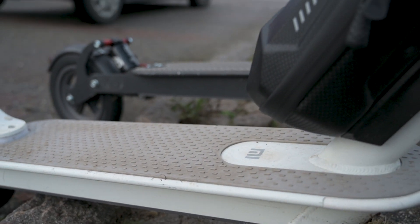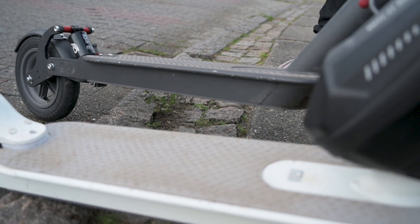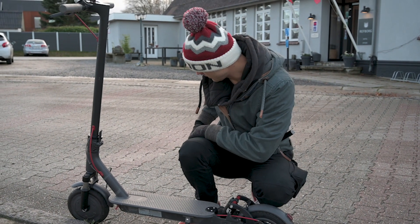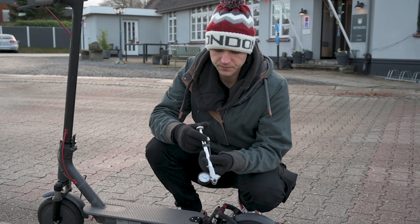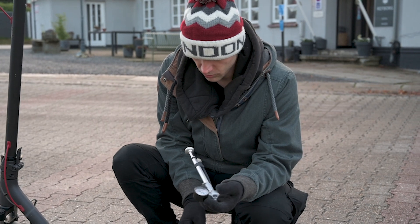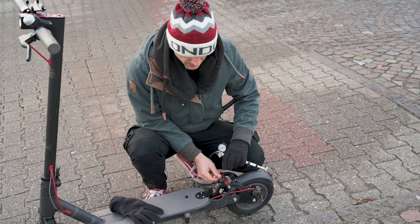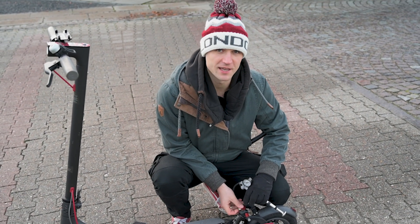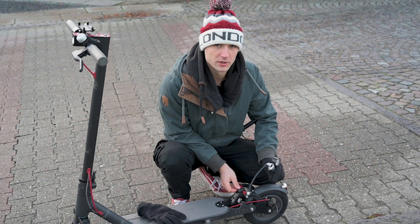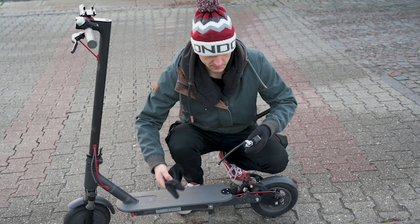As you can see, the white scooter is actually hitting the curb before the wheel goes on, and the black one you can just roll on curbs without worrying about bumping. I will try and adjust the suspension — it's pretty easy to do. You just need a normal mountain bike shock pump where you can see how much pressure is in the shock. You need to take off this little cap and attach the pump to it. This is the best part about the suspension — it has this air shock which is adjustable with pressure and you can really make it fit your body weight.